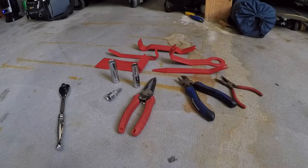For today's install you need a 3/8 drive ratchet, a 10mm deep socket, a 13mm deep socket, a T40 Torx bit, some wire cutters and snips. You shouldn't need strippers but keep them out just in case, needle nose pliers, some plastic pry bars, and you could need a rivet gun because we're going to remove some of the rivets on the fender liner.